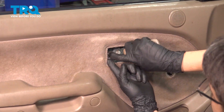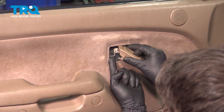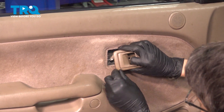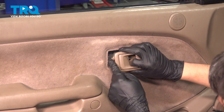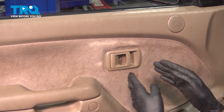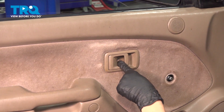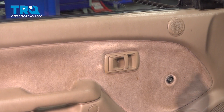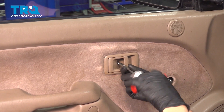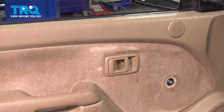Pull out on the rod here and get it lined up with the door handle — it's going to have a little hole that it hooks into. Take the plastic clip and lock it in onto the handle or onto the rod itself. Line up the handle a little bit forward of its actual position because there are some hooks that hook backwards — once they slide in, push it back. That'll lock into place and the screw in the center will be perfectly lined up. If it doesn't line up, your hooks on the back are not in position. Tighten up the screw — it's going into plastic, so just snug it up a tiny bit, as these strip out very easily.